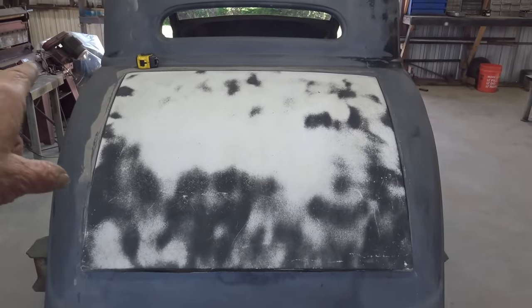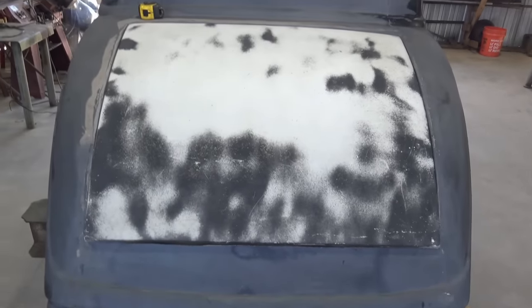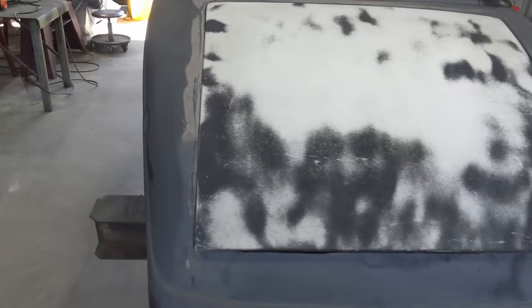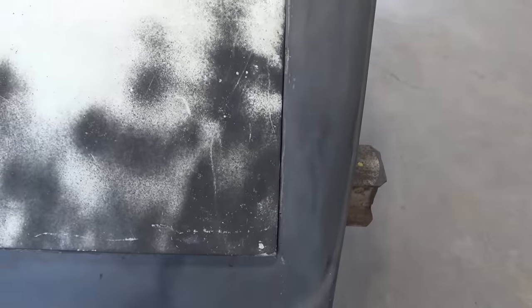That trunk lid only goes one way. It's wider across the top than it is across the bottom at the back, like a half inch wider. So I tried to turn it around the other way and it don't fit at all the other way. But you see, it's got a really tight gap. I'm about to narrow it down a little bit. Not a lot, but a little bit. I gotta trim it down sideways, make it a little bit more narrow, not much.